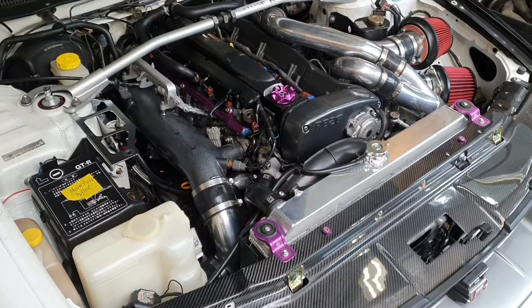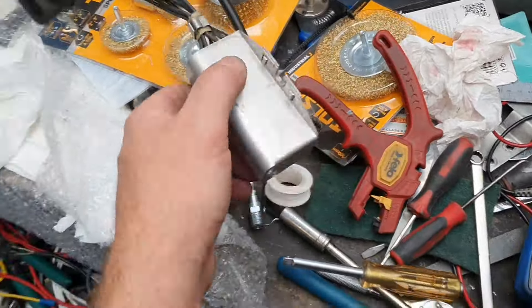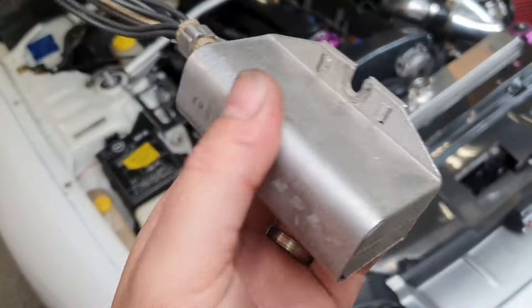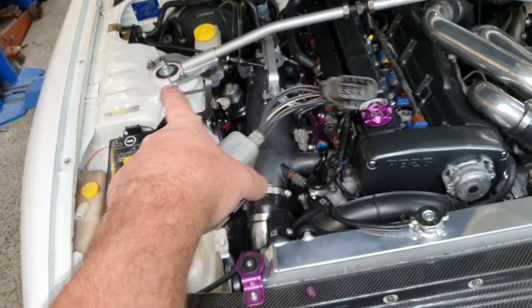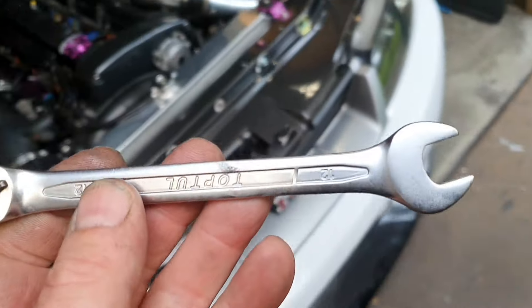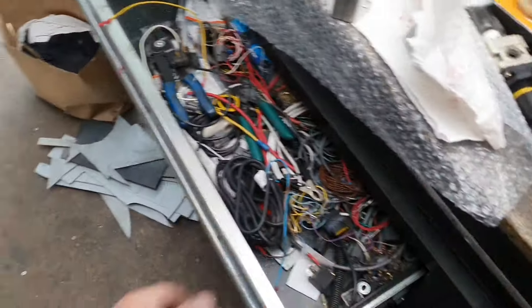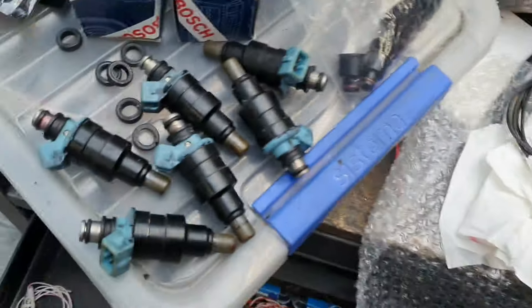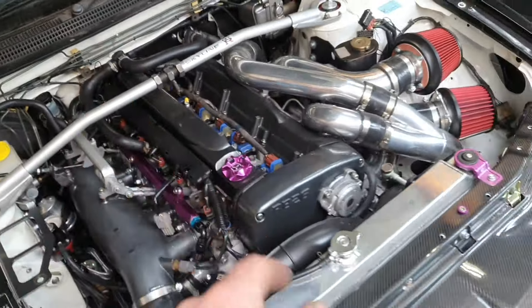There was more things happening — it's running again. More blood — it likes taking blood. I took this boxy thing here with electronics — the resistance — we defeated the resistance that normally lives in there. There's actually a big bracket that's missing off this car that normally goes in there, and we don't need that anymore. Also found a spanner — whoever lost that many moons ago, it's mine now. It was underneath the brake master cylinder. We took the resistor out because we put some different ones in — it's got 1,000cc injectors now because we've got a nice computer and it's easy to set up.